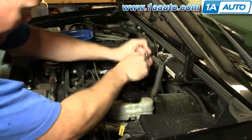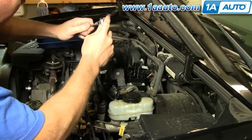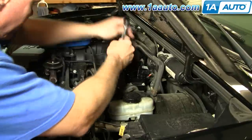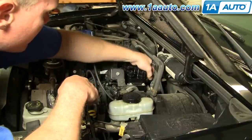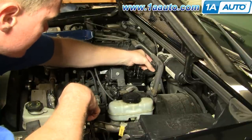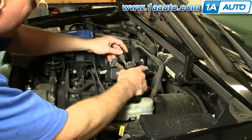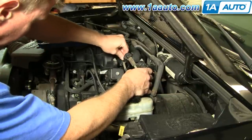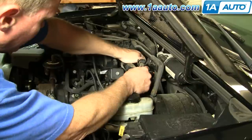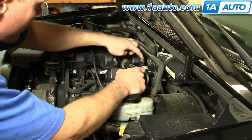Let's check these and make sure they're as tight as I want them. Put our connection back in. And then our wires — I've got number three here. The marks I have on these wires have nothing to do with the cylinder number; they only pertain to the closest one to me being one, then two, three, four, five, six, working around clockwise.